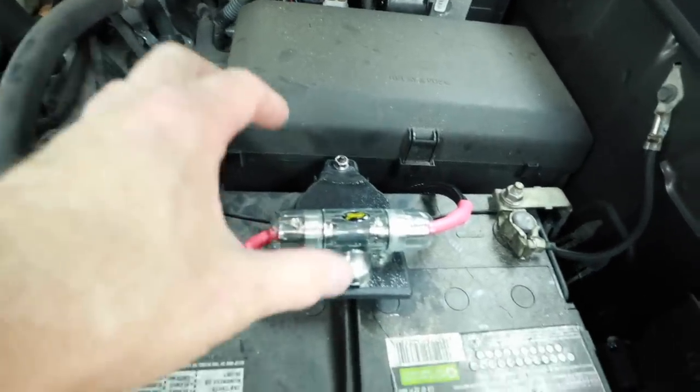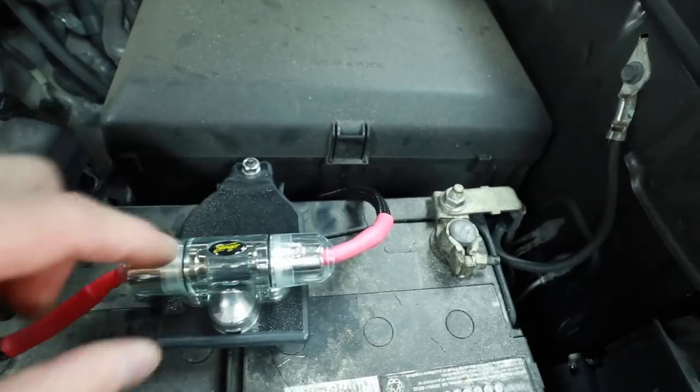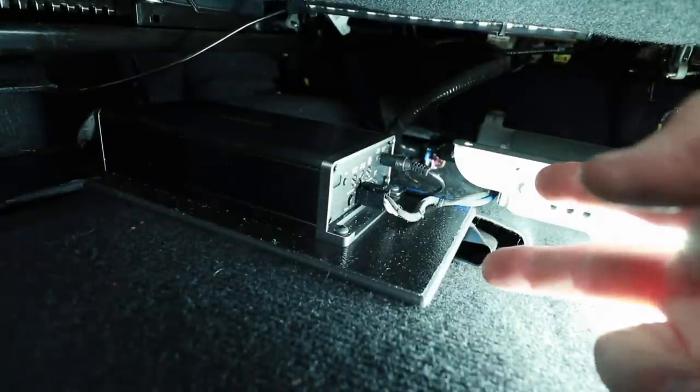The last step of this installation before tuning is the fuse holder, which Fernando is working on. What Fernando's come up with is our standard battery mount — we bend a piece of quarter-inch ABS, add a second bolt here, the whole panel will remove, the fuse holder disconnects from this mount, connects to the battery in a very short run. We can then turn it on and start the setup process for the amplifier. There are some test tracks you need to download from Kicker's website, so make sure you do that. You can put them on your phone through Dropbox or burn them to a thumb drive and put them in the USB.